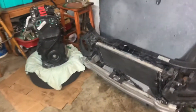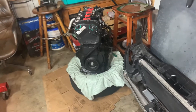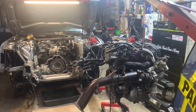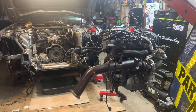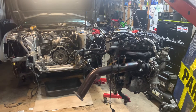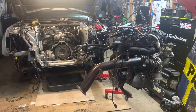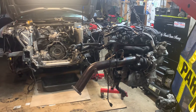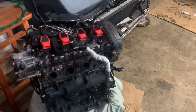I'm not going to attach everything to that engine because it'll probably just break when he goes to transport it — just let him take the box. That engine needs to be cleaned down and rebuilt anyway, so there's no point bolting anything up to it. This engine has very low miles compared to the old one, the intake ports are very clean, so this car is going to feel very lively. It has a stage three clutch from Clutch Performance, got all new gaskets — it's not going to leak anything. The old turbo was leaking, valve cover was leaking — we went through two boxes of brake cleaner cleaning it up. She was a leaker.